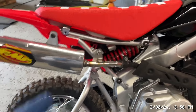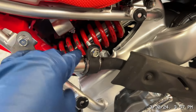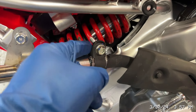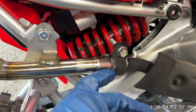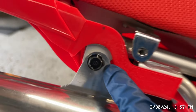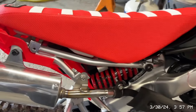Okay, so I'm just going to quickly go over what I did and I think it ended up working. So there was that lead gasket thing — I actually cut it in half, put it on the outside of the FMF slip-on as you can see here. Then I took the OEM clamp that didn't fit because it was too big a diameter, put it around the gasket, and I was able to close it in. I tightened it all the way down and pushed the whole thing all the way back.